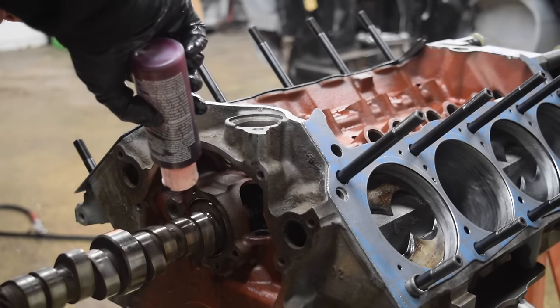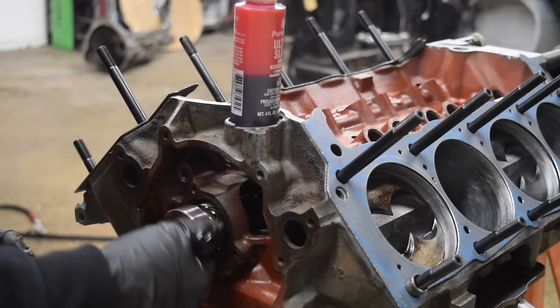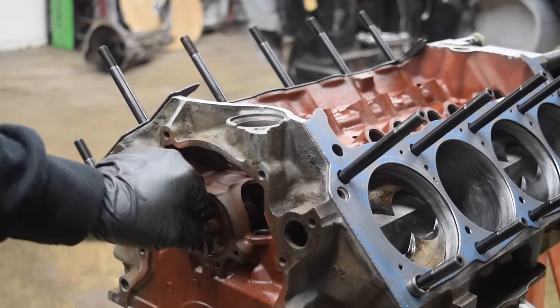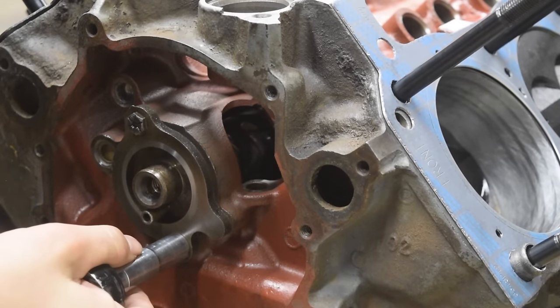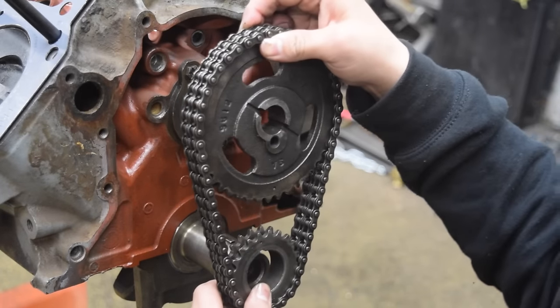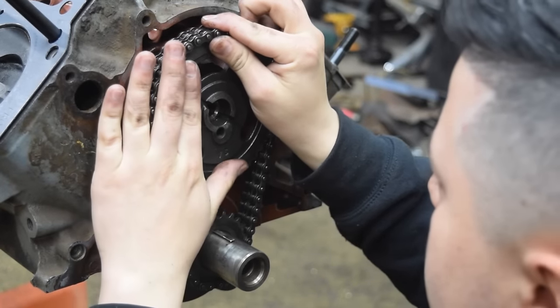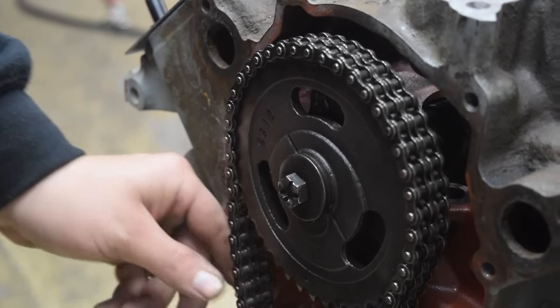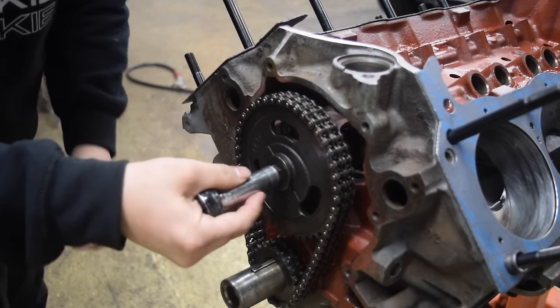Some people were also concerned that I didn't check the end play on the crankshaft — well, I don't have a dial indicator, so that's why it did not get done. Going to rotate the crank so we can get our timing set. The good thing about not having the cylinder heads installed is you know when you're at top dead center because you can see the piston. Going to torque these down to 10 foot pounds. For the timing set, to make my life easier, I have not separated these — they are going back exactly the way they came off. Our timing chain is not as tight as I'd like, but it's not loose enough to say it needs immediate replacement. Cam bolt is getting 40 foot pounds.